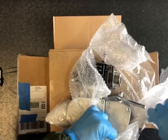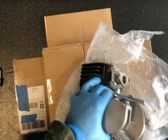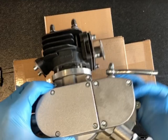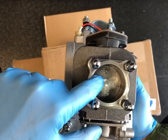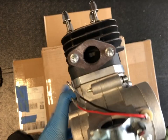There it is — nice, clean case with the cylinder pre-installed. Most importantly, this is a hybrid, not a conversion. We didn't just swap one cylinder out for another and jerry-rig a spacer. What has happened here is that we've integrated the 49.9 cubic centimeter Minarelli top, with the spacer, on an Olen Triple 40 engine case. There's a 47 millimeter piston in there and it is windowed.